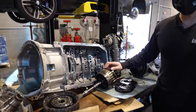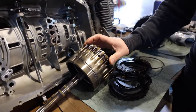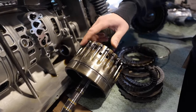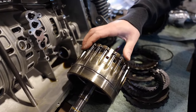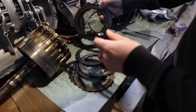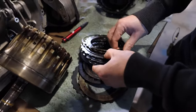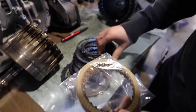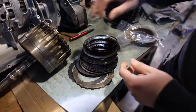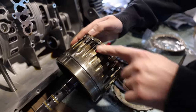You're commonly going to see a fault code for Clutch E. You can look at the Clutch E adaptation numbers — on the 6HP 26, adaptations are going to go above 750. This discoloration right here is from excessive temperature, and you can see the burnt clutches, the friction plates. This is not the worst we've seen, but compared to brand new clutches, you can see the excess temperature has burned all the way through.